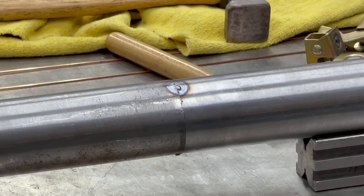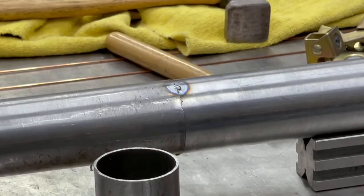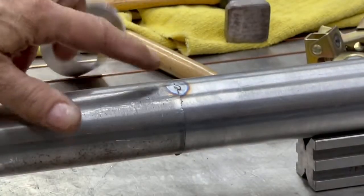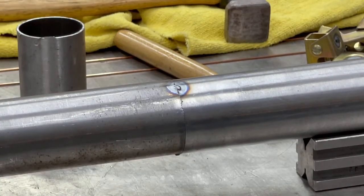So, yeah. Cut this out. Basically 65 millimeters right here. I tacked it in three positions and then I dollied it with a hammer on a flat plate to get it as close to get the edges nice and rolled in, and I'm just going to seam it up. So, yeah. I think I'm going to put it on time lapse for that. Stand by.